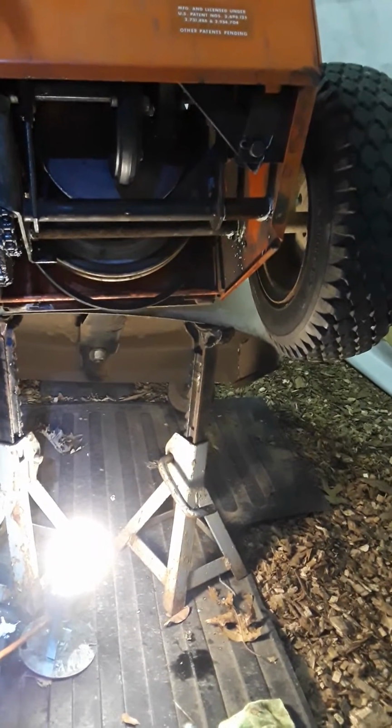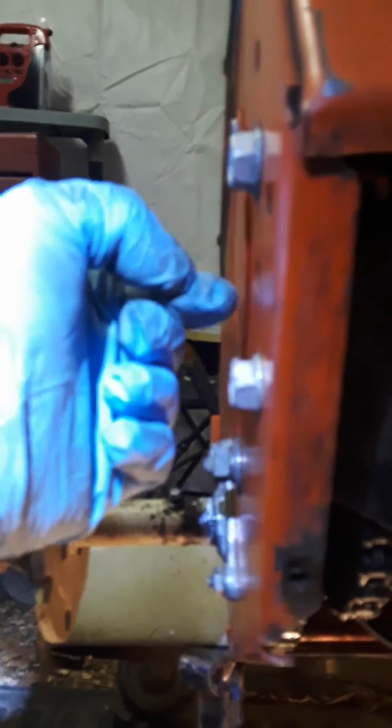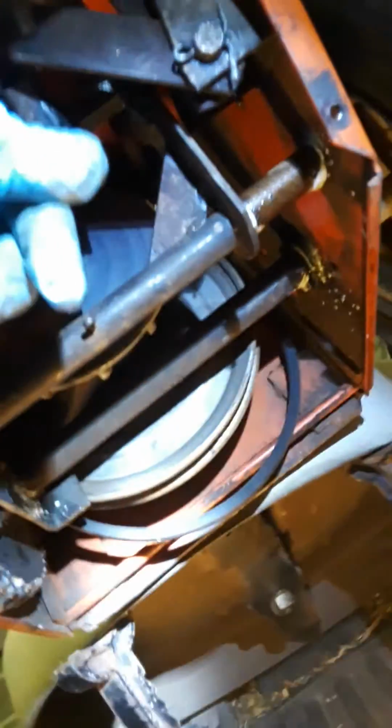Okay. All right, once you remove the wheel, you remove the lock nut on the right-hand side of the hex shaft. Up here, this is the hex shaft. There's a bolt on the end of the hex shaft, which you get from this port. You remove it. Once you do that, on this side, you remove these 4 lock nuts, and the whole bearing there comes apart, and then you'll be able to pull this whole hex shaft out of the left-hand side of the tractor. Once you do that, the friction wheel still sits there. It'll still sit because it's hanging from up above, all right?